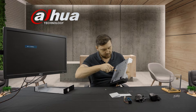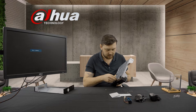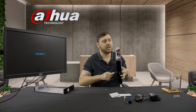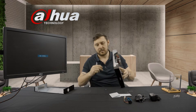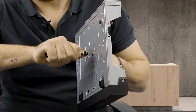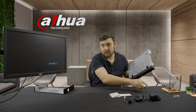As an installer, a lot of people I used to deal with would say they only put two screws in because two can hold it fine. The thing is, after a while with these recorders as they get older, if there's no servicing being done, there could be a little bit of vibration from the fan or even from the hard drive over time. So it's best to have all four screws nice and tightly secured. And you are getting the screws with it, so might as well use all of them.